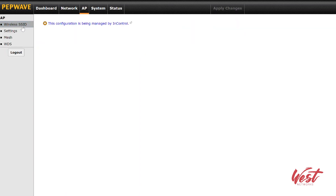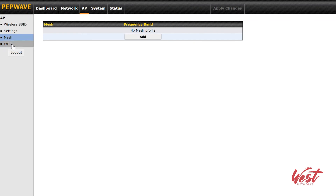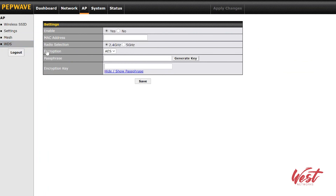If I go to my AP tab, you can see I've got my wireless SSID — this is being configured by InControl. If I turned off InControl, I'd be able to configure that same SSID right here. Two features built into the PepLink AP worth highlighting: first is the wireless meshing capability — you can mesh PepLink APs together with a PepLink router. If you program wireless meshing in the PepLink router it'll automatically program your APs, but you can also manually come in here, click Add Profile, give it a mesh ID, enable a pre-shared key, and choose either 2.4 or 5 gigahertz. If all your APs and router have the same mesh ID they'll all mesh together. We also support WDS — you can add the MAC address of the remote AP you want to connect to and do the old school manual WDS.